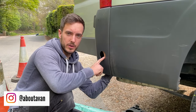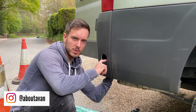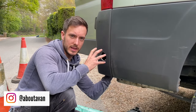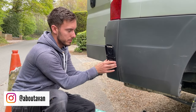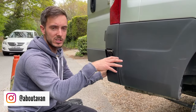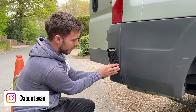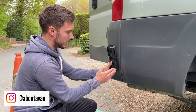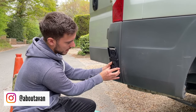I've got plywood on the inside — it's going to go into the bumper and that flexes a little bit as well with the plastic if there are any shapes or contours. The barbecue point is going to go on there and the screws are going to catch in the plywood so it's not going to move around in future and it's going to get a nice seal. Now I've got the wood on the inside and the Bullfinch barbecue point back in. When putting stuff into bumpers or bodywork, I try to line it up on the same angle as something else so it looks nice and neat. If you angle it like that it's going to look crooked, so the best thing is to line this edge up with this piece of trim here — that's just going to make it look nice and finished.